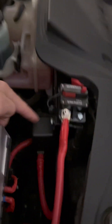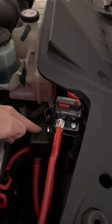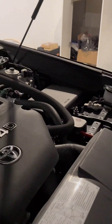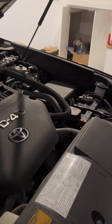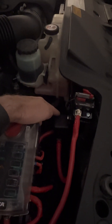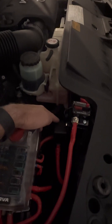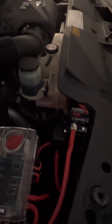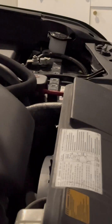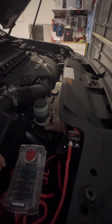...a relay here, so the power is actually live only when the car is on. I've run the switch that turns that relay on from my fuse box. I've run two cables. You don't have to do that, but it is recommended to run a relay so that the power on those extra five terminals is only on when the car is on. Otherwise, you might flatten your battery when you've got your car parked and connected to the trailer.